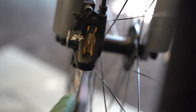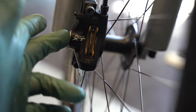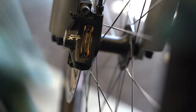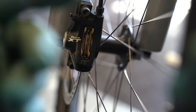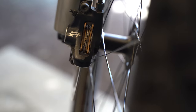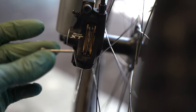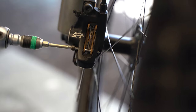Now we have the brake pads and we're going to go ahead and put them in. Of course you can put them in from above, but that is not true with all calipers — sometimes you have to put them in from beneath, especially with lower end models, and you may have to remove either your wheel or your caliper. But once you have perfectly centered your caliper, you may be reluctant to remove it again, so trust me it is worth the effort to just remove the wheel, put in your brake pads, and then place it back in. Be sure to again place it on the floor and push down firmly onto the handlebars so the wheel is nicely placed. Also don't forget your pin or screw that secures the brake pad.